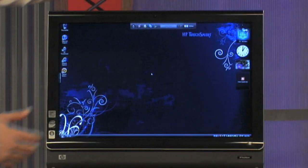There are a few ways that you can perform a system recovery. One way is to create recovery disks, and you recover from those disks. You can create them yourself or get them from hp.com. If you're going to recover from the disks, make sure that your computer is on, insert your disk into the drive, restart your computer, and when the computer starts up, it'll go right into your recovery wizard — just follow those steps.